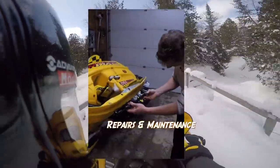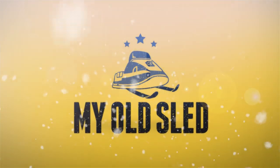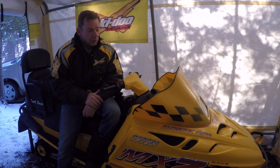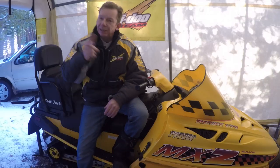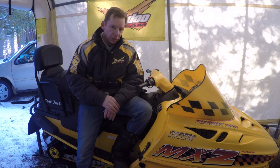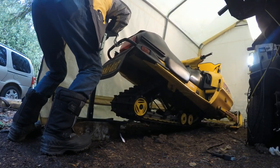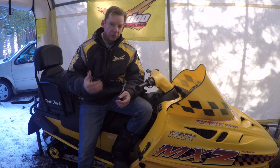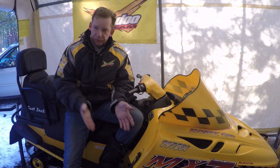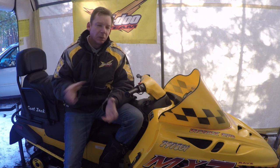My first question is from one of my subscribers, GP Outdoors. He does not have a shed and he typically stores his snowmobile sitting on the ground with a cover over it. He's heard that you shouldn't leave it sitting flat on the ground with the track on the ground and he's asking if that's true. A lot of guys will do what he does — it's not going to be disastrous. I did another video on whether you should use a snowmobile lift and talked to a bunch of dealers. It comes down to personal preference, but in my opinion you should lift the snowmobile off the ground whenever you're not using it. If you've ever had a flat tire sitting in one place for a while, you know what happens to rubber. The track is pretty tough and the lugs probably won't deform a lot.